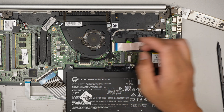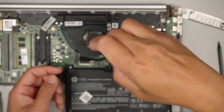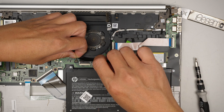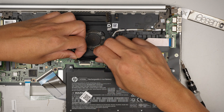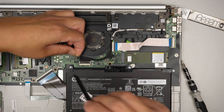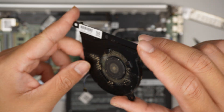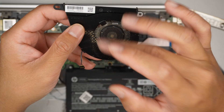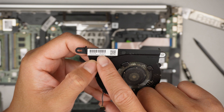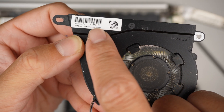If in your case the CPU fan is stuck and there's nothing that can be removed — meaning the motor might have gone bad — then you'll need to change out the CPU fan. I'll still show you how to do it. Remove all the screws; there are three screws holding it down. The connector is very straightforward — it snaps on, so to remove it you just lift it straight up. The entire CPU fan will just come right off. The product number is L68134-001, which is the replacement CPU fan model.